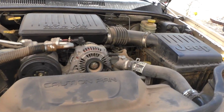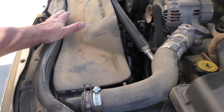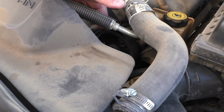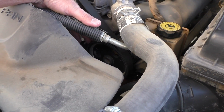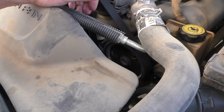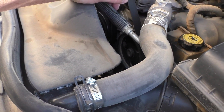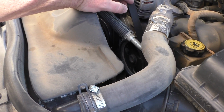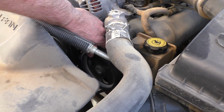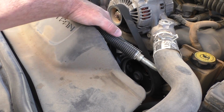Last but not least, this has a hydraulic fan in it, where the cooling fan, if you're not familiar, runs off the hydraulic pump. And that pulley right there, if that pulley goes, you're dead in the water. That's not just the power steering pulley, it's for your cooling fan. That's what happened coming back from a trip. That pulley disintegrated. Bad pulley or something, I don't know, but it was making that same exact high-pitched whine that I got the last little bit going up I-17 when I went to Turkey Creek. So that's suspect as well.